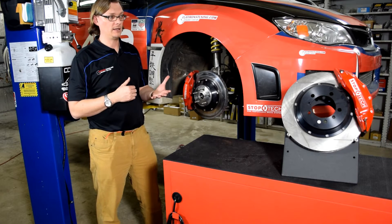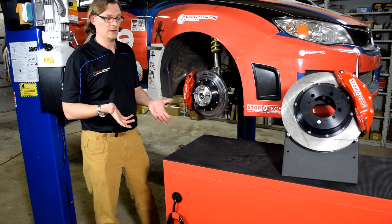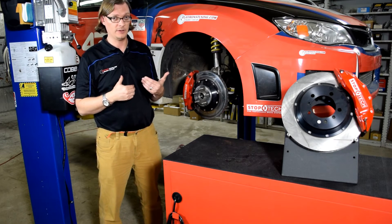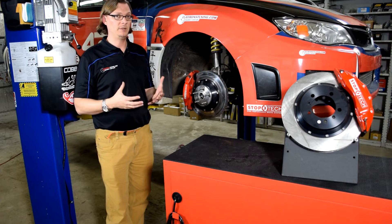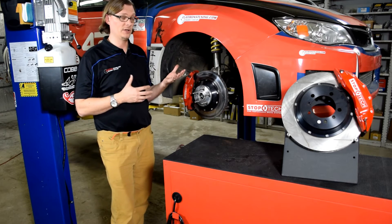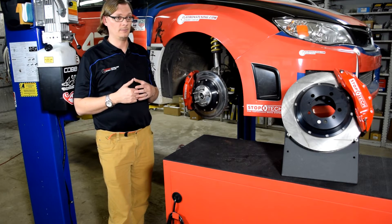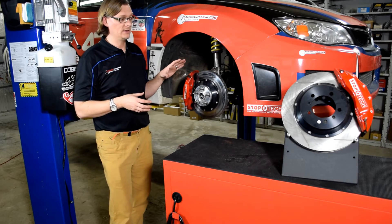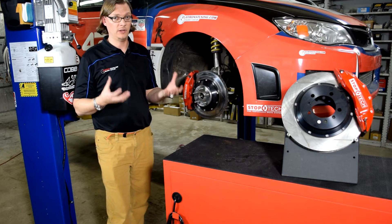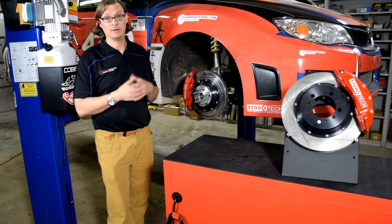The next year we came back, we started adding more aero — more downforce, more grip — and we were running compound tires. Even though the brakes performed adequately, every time we bled the brakes the fluid would come out jet black, and we noticed a lot of wear on the rotors, even though this race car sees hardly any miles. We really got the sense that we were overheating them. We added brake ducts to get more cool air to the brakes, but the aero was giving us enough load up front that we were basically overheating and compromising the front brakes with that existing caliper.